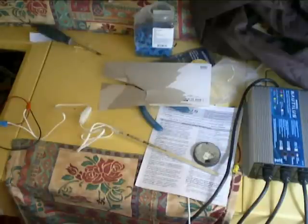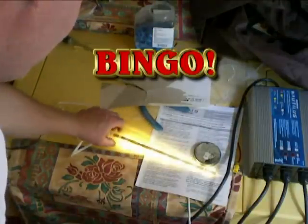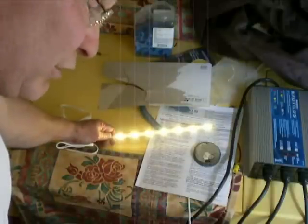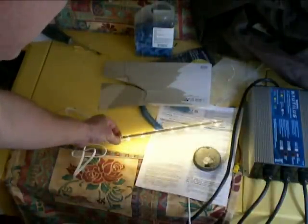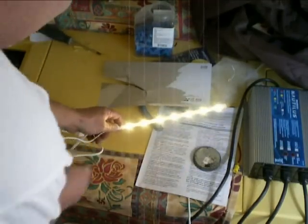The next step is to turn it on and try it out — see if it works or blows up. Everything is hooked up. There we go. Now, one thing to note: these are 12 volt lights, but your actual battery can push out 14 volts or so when charging or even in a good charge state. So I may leave these on for a while just to see if they can withstand that constant voltage. If it's anything over 12 volts they may fry.